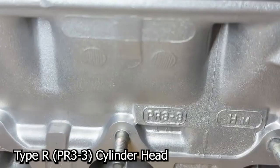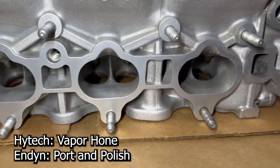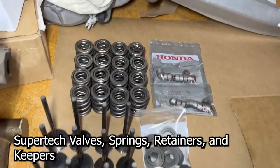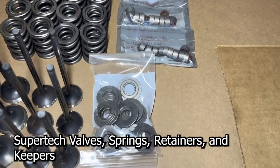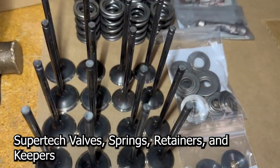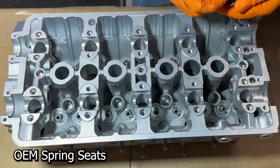Check this out — this is a Type R head and it has been vapor honed. It's also port and polished. Check out those beautiful intake ports. We've got it all cleaned up. And we're also going to be installing a whole bunch of Supertech stuff: valve springs, new OEM valve seals, spring bases, retainers, brand new o-ring keepers from Supertech, and all valves are Supertech as well. This is for a Type R build here at High Tech. Let's first install these spring seats.